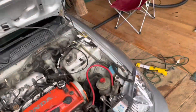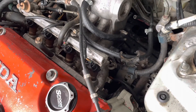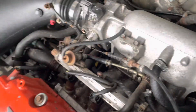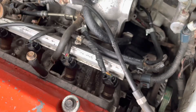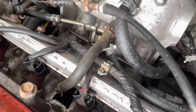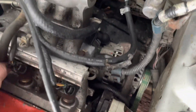Come back to you guys when I'm done. Got everything on. I think the last thing I showed you would have been me putting these hoses on — so there's that one, then the other one connects to the bottom of the air control valve. We got the MAP sensor plugged in, the TPS is plugged in, air intake temperature sensor is plugged in, throttle cables on, regulator on, return fuel lines on, all the fuel injectors are plugged in, fuel rail in.